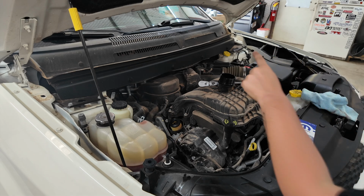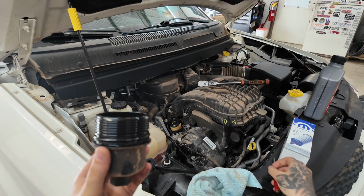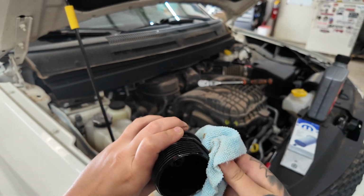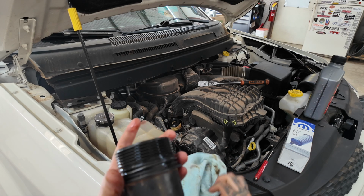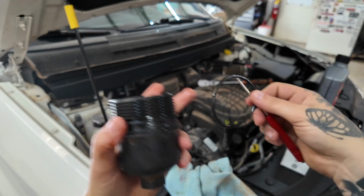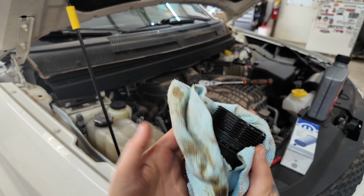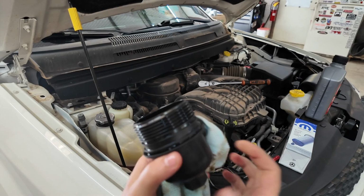And then the same thing goes with the new and old O-ring on the canister lid. Now with this O-ring, there's a couple different ways you can get it off, depending on the tools you have. You can take a towel and pinch the sides so that you can grab it and then roll it up and out. So that's one way of removing it. You can also use a little screwdriver or a pick to pry it up, such as one of these. Tuck underneath there, pull it up and out. So it's whatever the user prefers, and what you have on hand, obviously. If you're limited on tooling, sometimes it's easier just to grab a towel and pinch it and pull it up. And some O-rings are tighter than others, so again, it just depends. But I always like to showcase a couple different ways based on application. People can try different things.